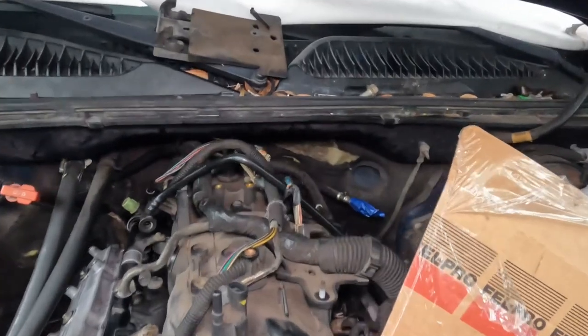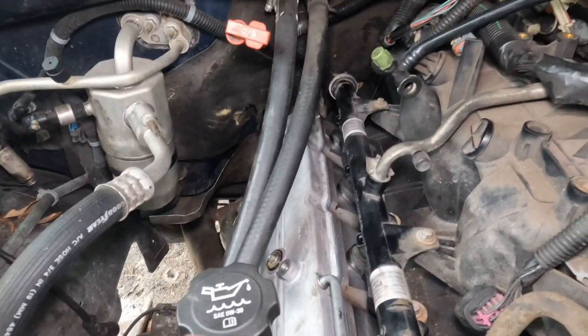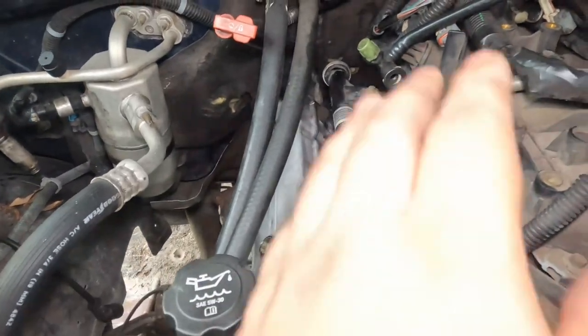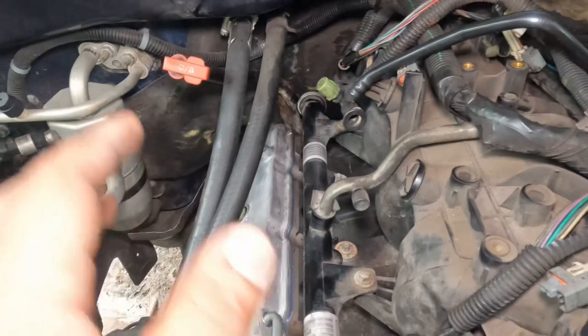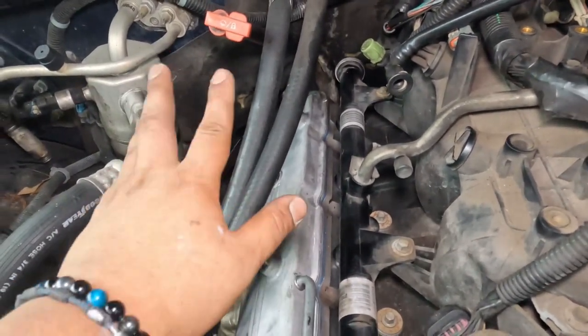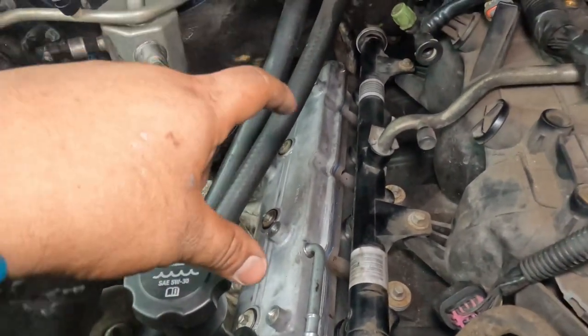Okay, so once we got all those bolts torqued down, I'm gonna go ahead and do the spark plugs and put the coils on there, just because all the wiring is gonna go over. So that's why I'm leaving all the wiring until after I have all the plugs and the ignition coils on there. So now let's go ahead and put the coils on there,